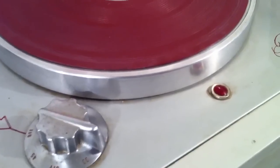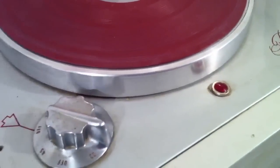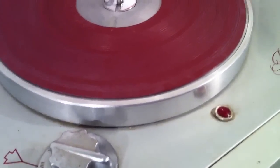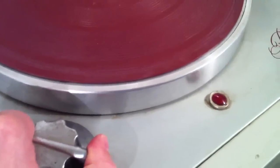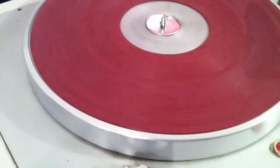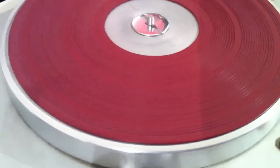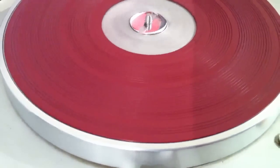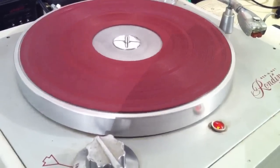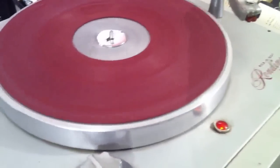It's an idler drive type system. Many of these older units either need a resurfacing, reconditioning, or replacement of that idler wheel. This is no exception. I noticed this one. See, the indicator light works. It turns on, but there's some definite noise there in between the idler drive and the platter that I know is not normal for these. So I'm guessing that's going to need to be either really cleaned up or resurfaced. There's some people online, I think, that recondition those as well.